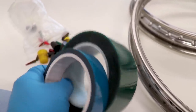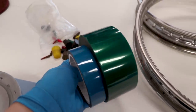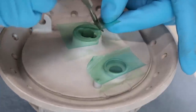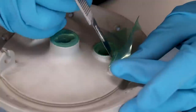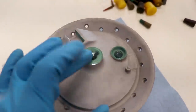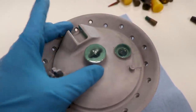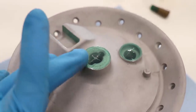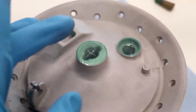Here's what I'm going to be using to mask off and plug the critical areas on the parts - got some silicone plugs and some tape, obviously made to withstand the heat of the oven. I'll have these linked down below. So I ended up just masking off these holes instead - it turns out a lot cleaner instead of using the plugs. So when you mask off a hole, you got to do a little relief cut in there, because when you run it through the oven, the heat will actually kind of shrink the tape and the tape will start peeling up around the edges. So make sure you do that.